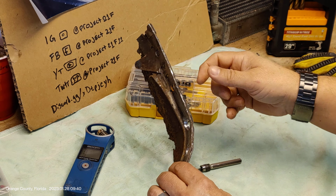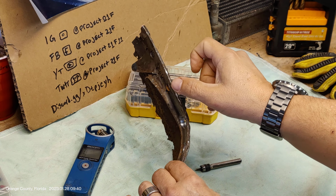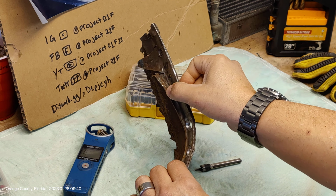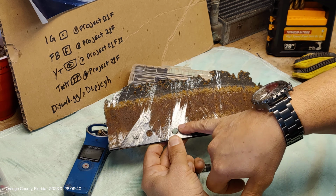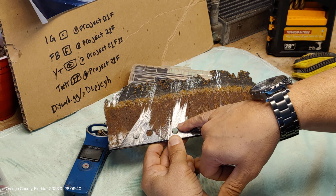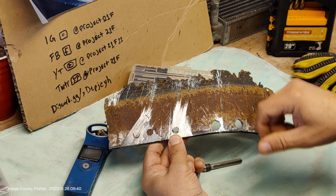And my thinking is that the pinch welder has to be held in place longer to fuse all 3 of these pieces together, which means that I believe that the welds may, in fact, on a convertible be larger or wider and more bonding area than a coupe or a fastback, which is where I think I had trouble.